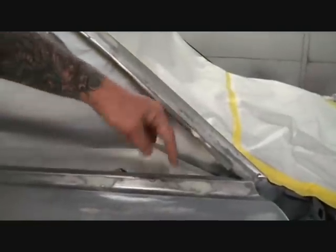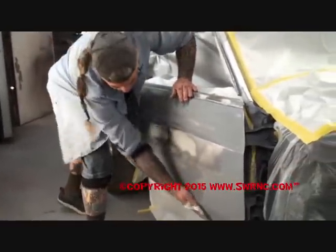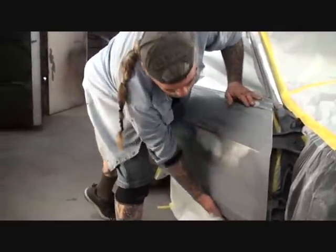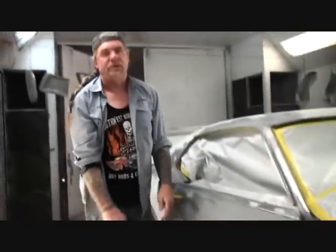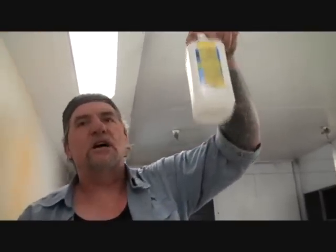We're going to come down here. I see a little bit of rust right here — this is just surface rust from leaning on it and touching it. We'll take some 80 grit and get rid of that. Then we're just going to wipe the car just like we would if we were going to paint it. Watch real close — I want to show you how quick this dries using rubbing alcohol or denatured alcohol. You can see that it dries very quickly. This bottle costs about 68 cents at your grocery store.